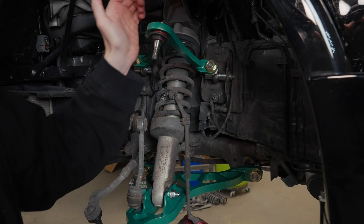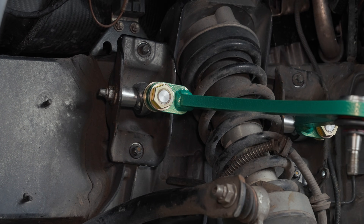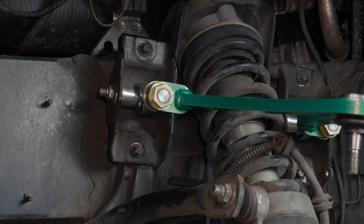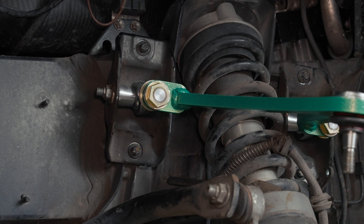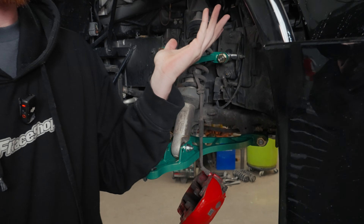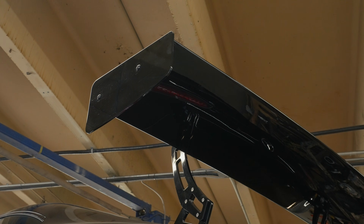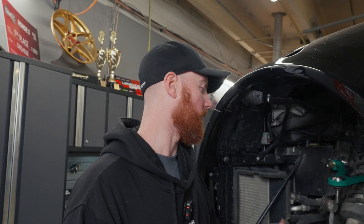The upper control arm OEM ball joint we made a press fit, and everything went really well. The only thing we had to do was change the inner tie rod. We looked up the thread pitches — all Mercedes typically use an M16 1.5 rack thread. We cross-referenced it with all the thread pitches we could find on other cars because we needed an inner tie rod that was 2 inches minimum, 50 millimeters longer than the stock one. The stock one was about 9 inches and we needed somewhere around 11.